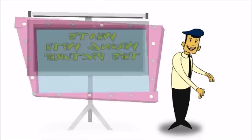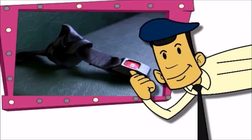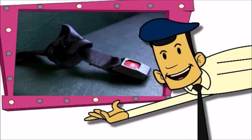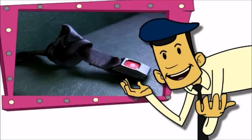Now let's play a little game I like to call: What's Wrong With This Picture? Take a look at this seat belt. See anything wrong? This seat belt has a couple of problems. The non-adjustable part is sticking out too far — it should only come out one or two inches from the seat bight. Plus, it looks like someone tried to shorten it by twisting it and putting knots in it.